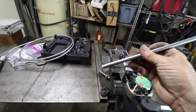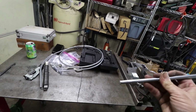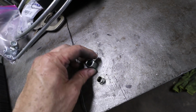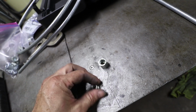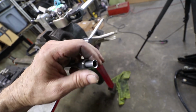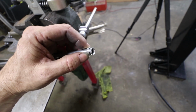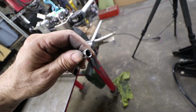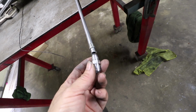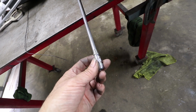And someone's going to say, oh, you forgot to put the tube sleeve on. And yes, you can just slide it over on this end, but when you do that end, you have to make sure you put the sleeves on first. This is called the tube sleeve, and it has that 37-degree flare on it right there. And then this is called the tube nut, and the two fit inside of each other, just like so. So when we slide it onto the end, what ends up happening is that this tube sleeve makes a perfect contact to the actual tube. So the actual tube is what makes the connection to the opposing AN fitting. So the formed part of the tube actually seals against the cone here on the fitting. And the nut basically just clamps it all together.